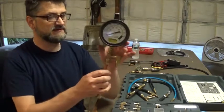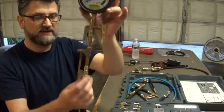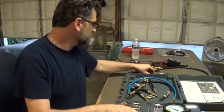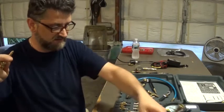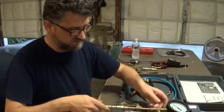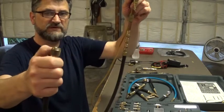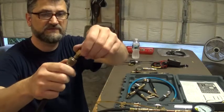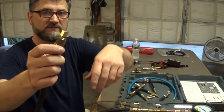What I did on this setup: I put some adapters on it, did a little plumbing, and now I have a female connector at the bottom. I can hook up my regular hose that hooks to the Schrader valve. If the Schrader valve is smaller, I have another adapter I can put in to adapt it to my fuel rail's Schrader valve.